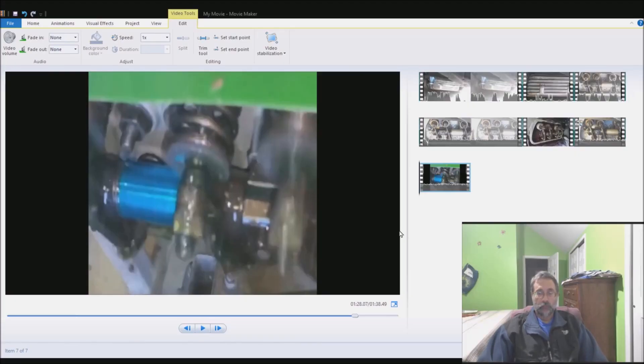This one is the one that I scarfed a while back and stuck into one of the Hoover mod videos about two or three videos ago. This particular motor is fully groove-modded, and they've also done the drilling — or the right removal, whatever you want to call it — to get some additional oil out up in this area.